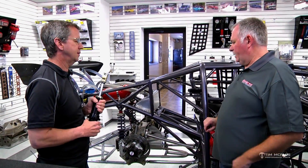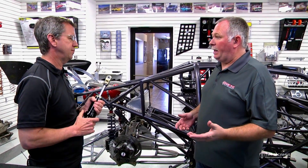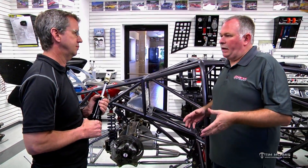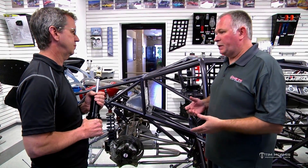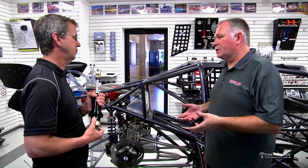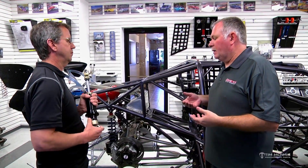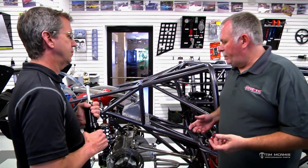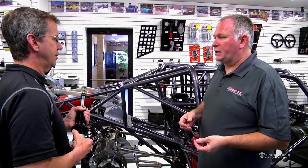I need a little more bite. A real common question we get is: the track was 90 degrees last night, it's 126 degrees today, and now the car has no bite — it's spinning the tires. A typical move would be to soften the compression and tighten the extension. That allows the tire to compress more, puts more bite in on the initial turn of the tire, and it slows the rate that the car comes back up, which keeps bite in the car. On a four-link car, that keeps the instant center a little bit lower, which puts bite in the car. So — soften the compression, tighten the extension.